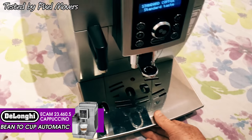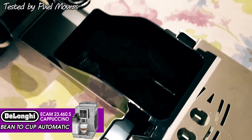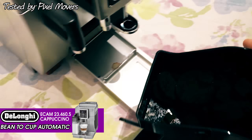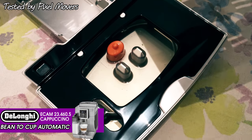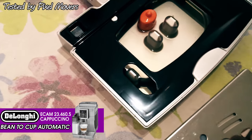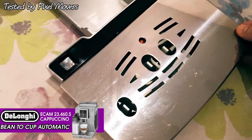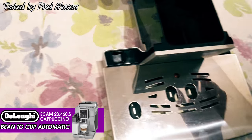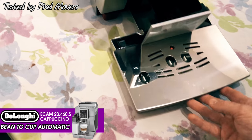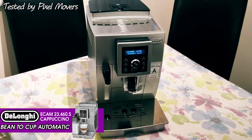And finally, this is how to remove the drip tray. You just pull it forward nice and steady. You've got a little plastic container there which contains all the coffee pucks that have dropped through - you just empty that out into your food waste bin. The chrome lid comes off the top of the drip tray, and the little red bit in there is the float, so if it gets too full your machine will register that and tell you it needs emptying - so it should never overflow. Once these are all emptied and clean, you just pop them back in and slide the tray back into place. Dead easy. Thank you for watching - this is the DeLonghi Cappuccino.